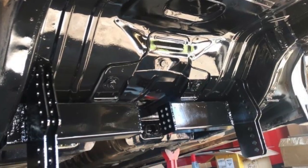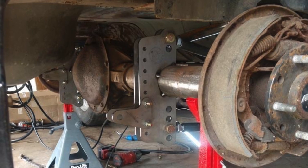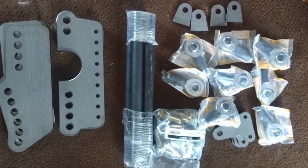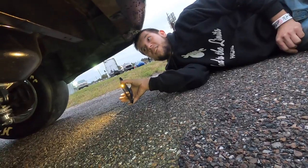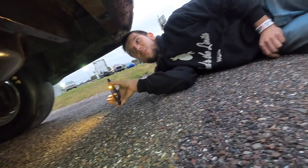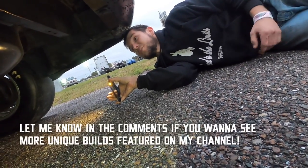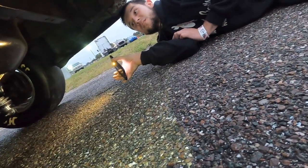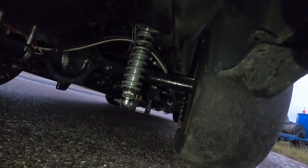Is your fuel cell in the spare tire well? I calculated everything up and it was only going to hold like 10 gallons. Could it sit lower? One of the problems I had was shocks — I couldn't find a shock that had enough travel. Most of them only had like 3 inches. I had to build other brackets just to drop it down without going through the floor. So that's a 4-link with a panhard in the front? Yeah. That's impressive that it's that simple.